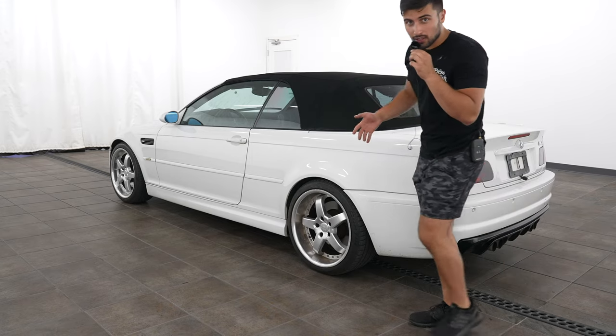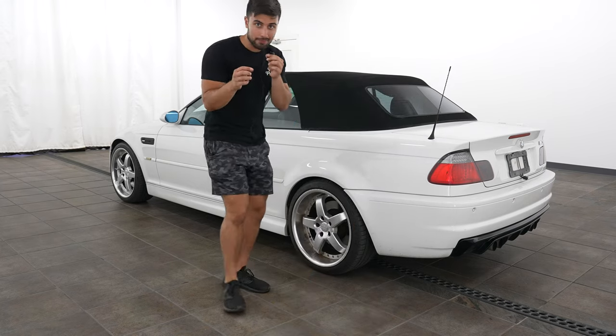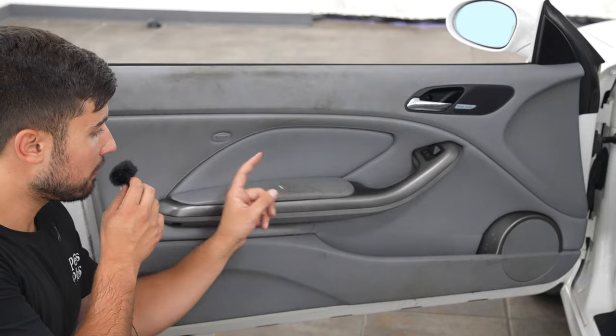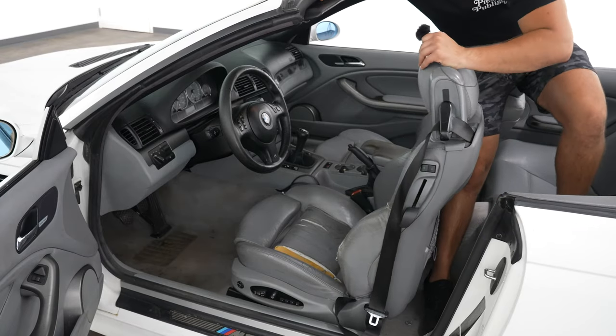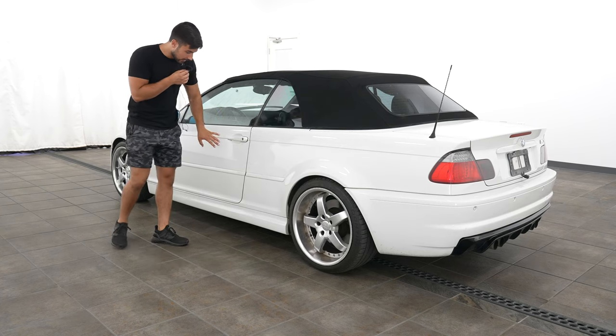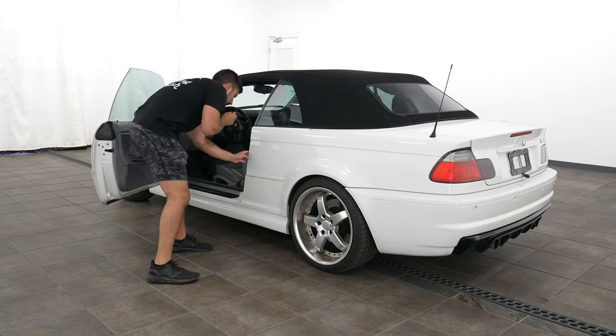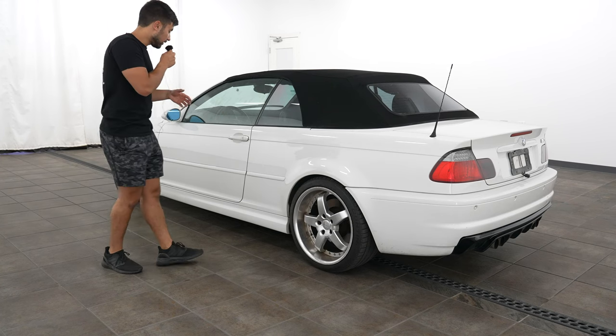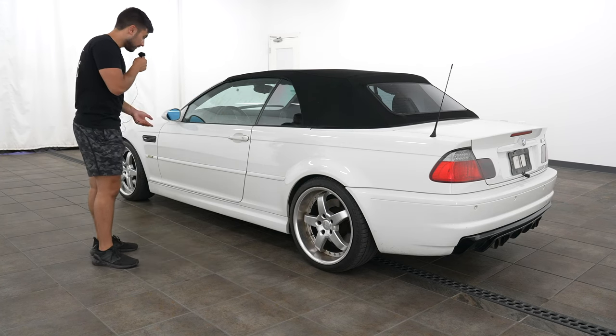If you guys are following along closely, you can see this outside is really not that bad. The inside is what's horrible, and you better wait to see, because that's what's going to be going through the craziest transformation. Everything here is super straight, no scratches or anything like that on this side. It doesn't look like it's been painted. If you look on the inner seams of the quarter panel, you can see there's no blend line. So that's a pretty good sign of knowing that you have original paint. All of the other stuff is in really good shape.